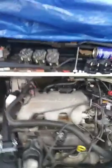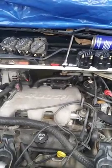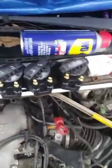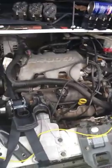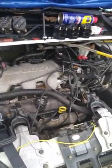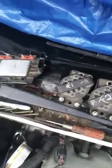But I do that so I can pull my coils out, set them aside, and know how to put them back when I go back, because I'm putting new coils on. So I mark the new ones the same as the ones that came out. Also, if you're new to mechanic work and have never done plugs before, make sure you mark your plug wires. And as you see, my coils are marked there, factory marks.